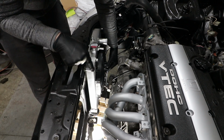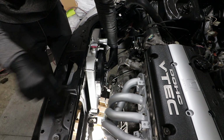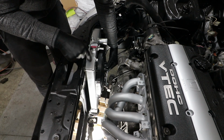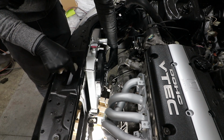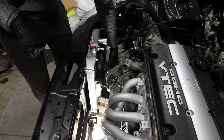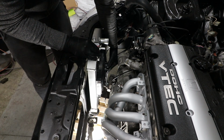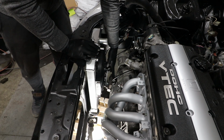Alright, so now that the radiator fits in the bottom mounts, I'm going to have to do something different since I can't find the existing mounts that I have. But I do have a horse mat here behind. I'm going to cut out some smaller circles and fit them in there, and where the pin or the mounting position on the radiator is, I'm going to drill the hole on this little circle that I cut out of the horse mat a little bit more forward so it can sit further toward the bumper to give myself that clearance, because if it were to sit exactly dead center on that old rubber mount, it would definitely obstruct that nipple on the slave cylinder.